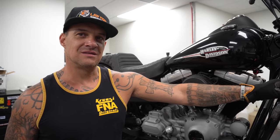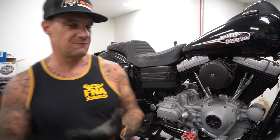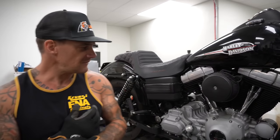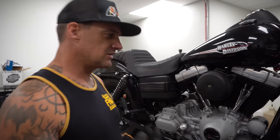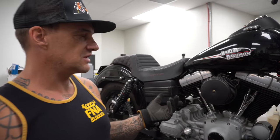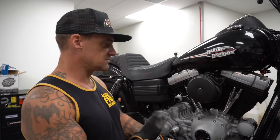It has been wrecked a few times — two good ones. Guardrails and whatnot. That's how you scrape the top of the pegs. So we're putting in a Fueling 574 cam and a whole Fueling cam chest. It's going to be a bit of a how-to video. We're also going to tune it — he's got a PC-5 Power Commander in it and we've already got a map from Power Commander. We'll just download it and run it. We don't really need to dyno-tune it.